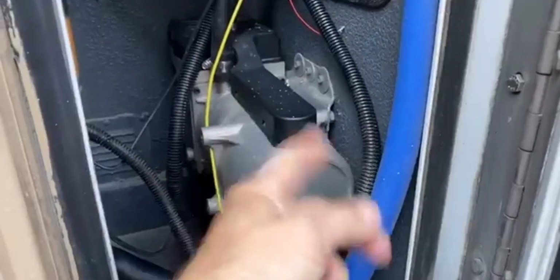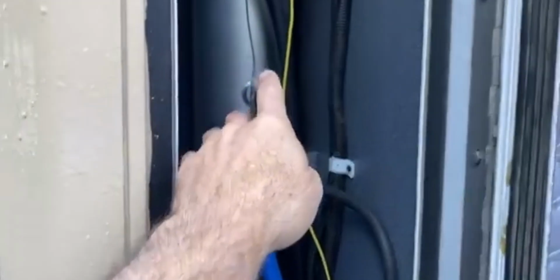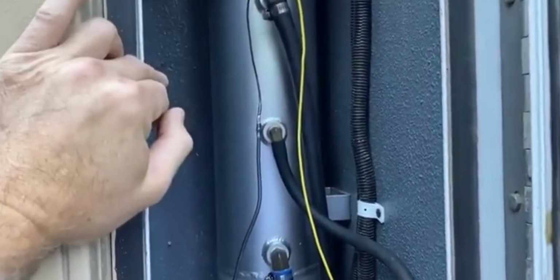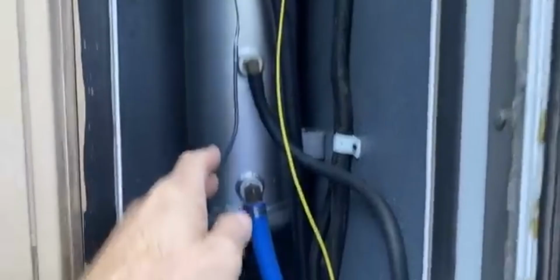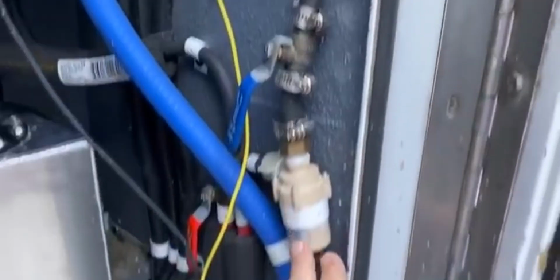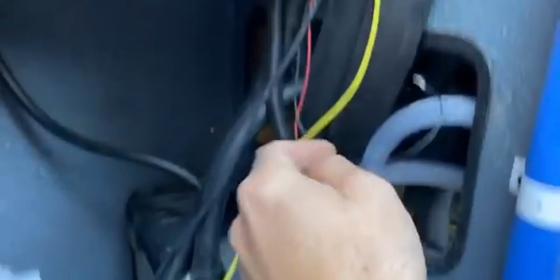So this turns on, pumps water up through these heater pipes in this tank and gets this tank up to 76 degrees Celsius, which is about 165 degrees Fahrenheit. And then this loop here is controlled by a thermostat to this mixing valve or this water pump, and it pumps through the floor. So we have radiant heat in the floor, and it also makes hot water.